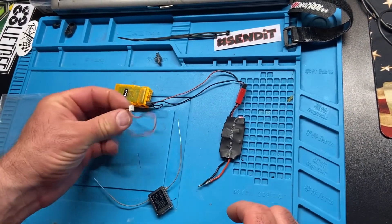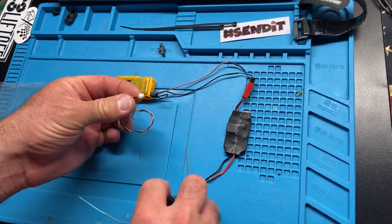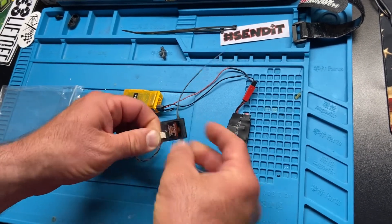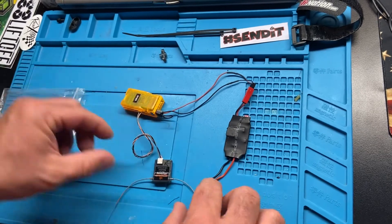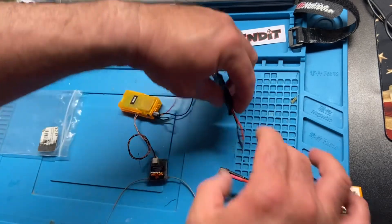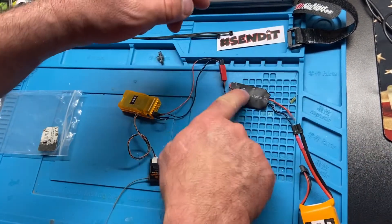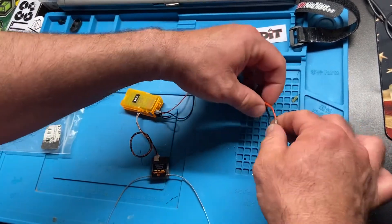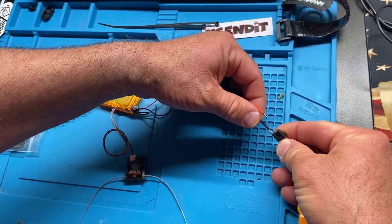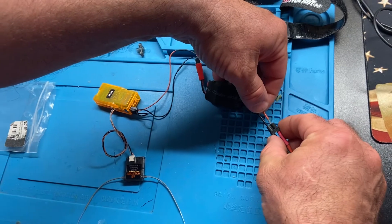With this little setup I have here, it makes things super easy. There's already the satellite cable sticking out of it. What you do is stick it into the receiver, which is already in your quad. It really doesn't matter the voltage that you use — this I think is a 3S LiPo so it has a BEC in it, so it doesn't matter. What you're going to do is take the power wire, the positive and the negative, and just be careful when you do this.